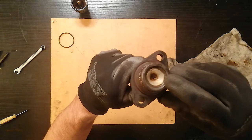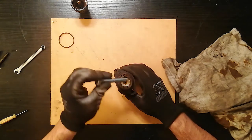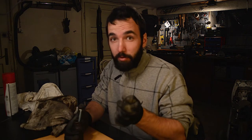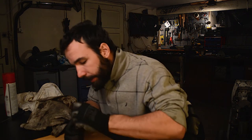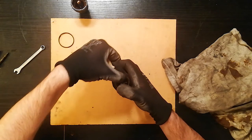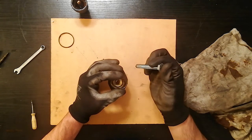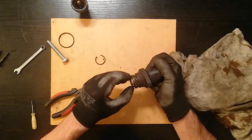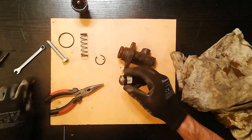There's a clip we need to take out so the cylinder can come out. To prevent it from shooting out in our face, I'm gonna use this bolt and press with my thumb while I pry the clip out. This is one of those operations best done with three hands — I only have two, so I'm gonna make do. Pry out the clip — it can be a bit tricky. Be careful not to shoot this out in your face either. Let's see if the piston will come out — I'm gonna try to help it a little bit. There it is.